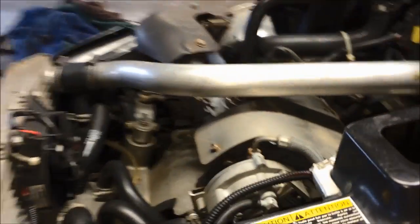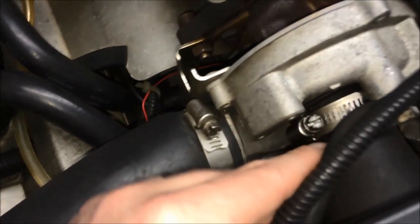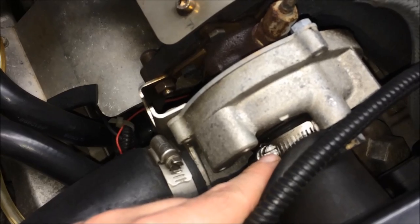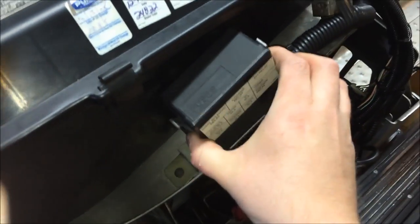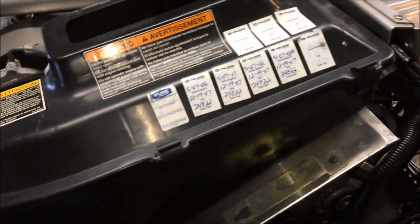As far as the air box, it's pretty easy. There is a hose clamp holding on to the turbo inlet that you're going to have to loosen. You're going to take off the relay box — this just turns forward. And then there's a hose clamp which is actually the vent from the oil passage that needs to come off, and then the air box comes right off.